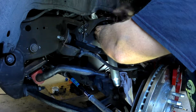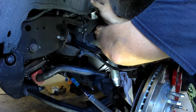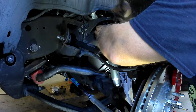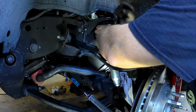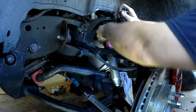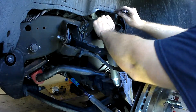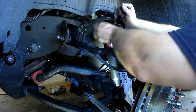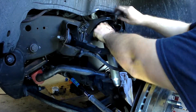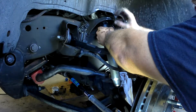Make sure we're good there. Then we'll tighten up our sway bar bolts, tighten up our inner tie rod end bolts, and we'll crank it up, let it run, and see if it senses these shocks before I go forward. If it doesn't sense the shocks and it throws an auto-ride light, we're going to need to snip this harness and set up our little modules.